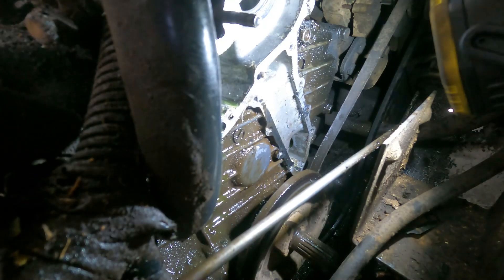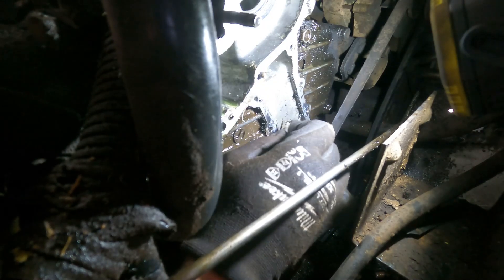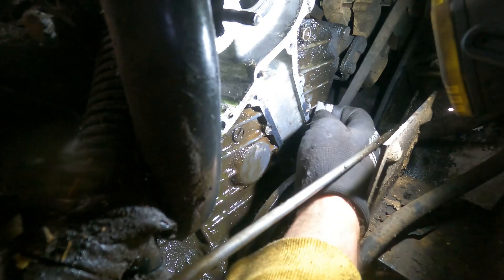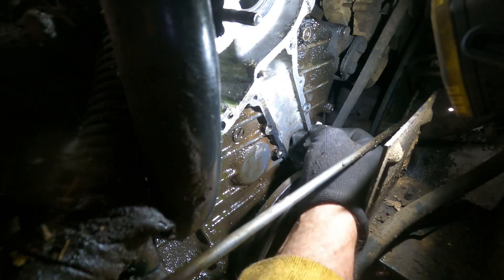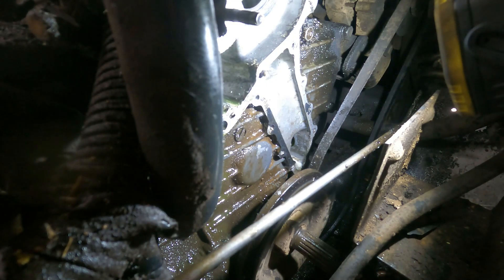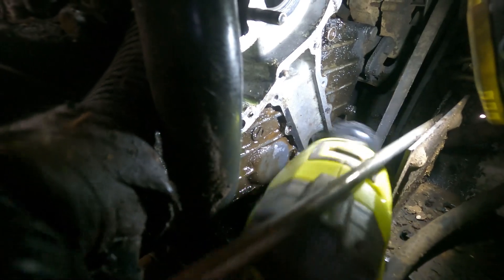I thought I'd share how I'm tackling these harder gaskets — it's hard as a rock. One of the things I found works to help degrade the gasket is spraying WD-40 on it and alternating with brake cleaner. WD-40 softens up the gasket, and the brake cleaner really just cleans the surface. The hardest thing about this is the location. There's not any gasket at the very bottom of the pump housing — it's over here. I really only have about an inch left on there.